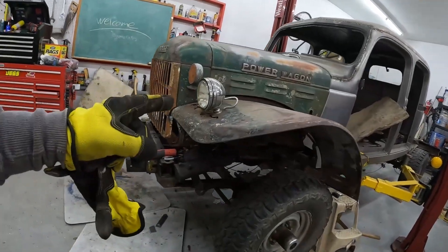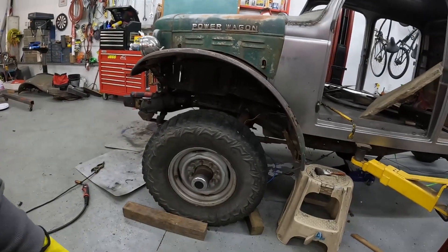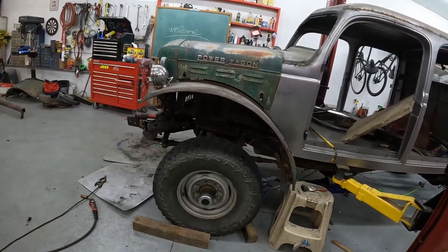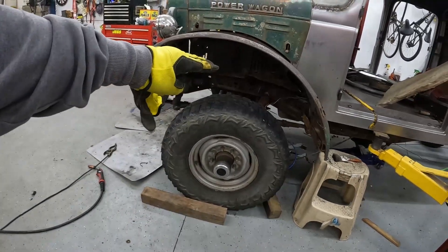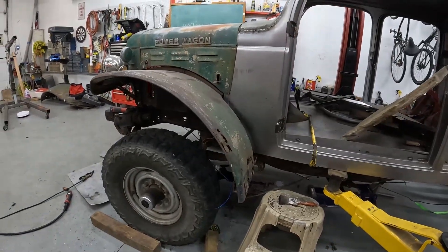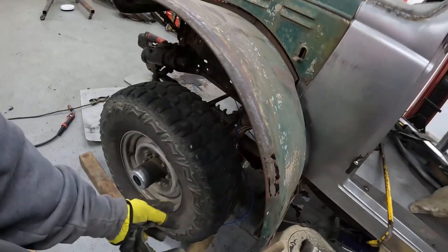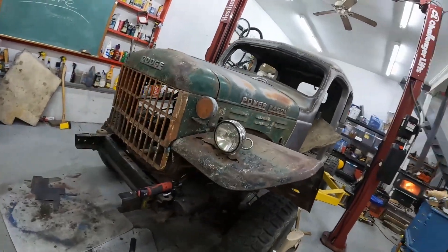The fender looks to be in a pretty good spot — maybe slightly forward. I gotta look at other people's trucks to see exactly where it should be and compare to the original truck. Remember, I'm gonna be putting probably 40s on this truck and these are like 30s. I got 35s or 37s sitting in the back so I might slap them on to see what it looks like. We got to cut this bracket and slide it in and build a whole new bracket, which will raise this up a little bit more.